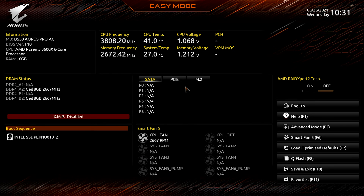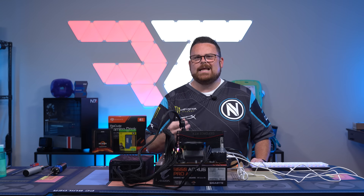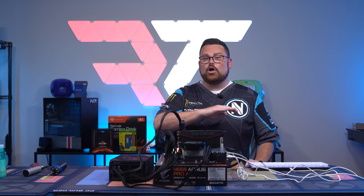Once you're in the BIOS, you can verify that your CPU fan works, that you can see your RAM, and that your M.2 is detected. You can update your BIOS, ensure everything is good, and even install Windows to verify there are no problems with any of your hardware. If you're using a cooling solution that isn't optimal for your CPU, I wouldn't recommend stressing the system, but if you have your actual cooler, you can do that too.